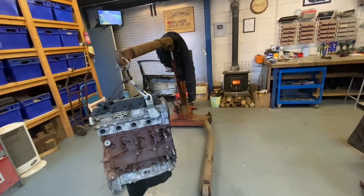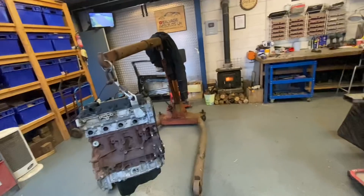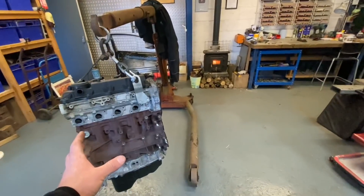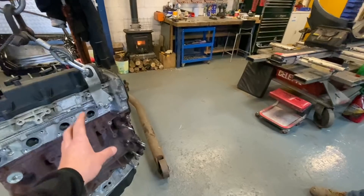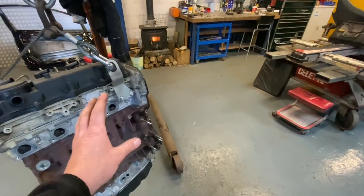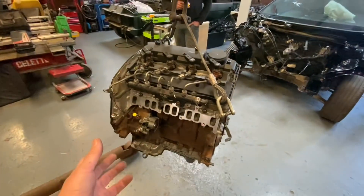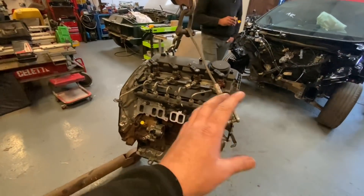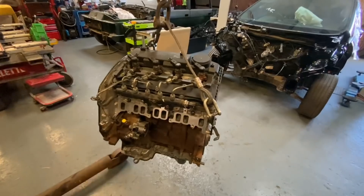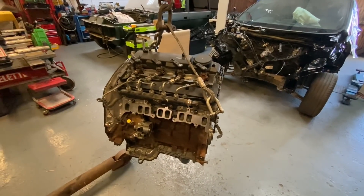There's a few hours of work here. Some people think it's probably the rest of the day — the exhaust side is probably the easier side, but that's still probably an hour and a half of work. Then going around to the really difficult side, because the inlet manifold has also got the wiring loom on it, and that's got to go back together correctly. So as Chris said, this is a good few hours of work — let's let him get on with it.